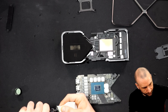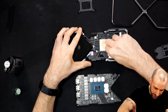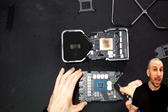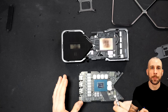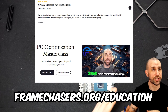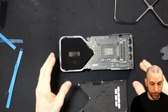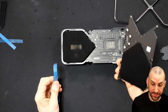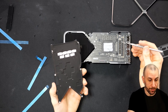So other than maybe a repaste and some thermal pad loading, there's not much more we can do. Let's go ahead and do that. We'll polish the copper first to make it nice for fresh paste. For those of you that watched my 5070 review video, you know my particular one has a lot of coil whine. So while the card is disassembled, we can fix the coil whine as well — I'll be including that step-by-step process in the PC Optimization Masterclass as a thank you to everyone who bought the course. Now that the repaste is done, the only other thing we can do to try and drop temperatures is load up this backplate with as many thermal pads as possible. The center here, right behind the GPU core, seems like a no-brainer.